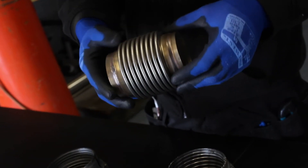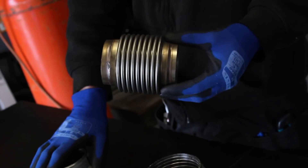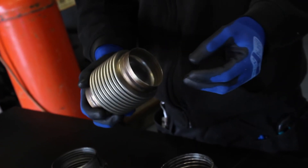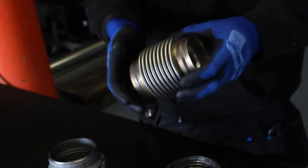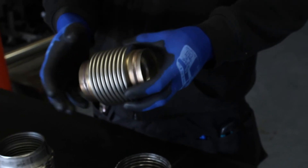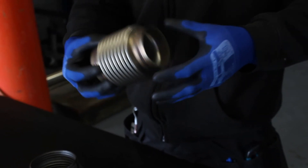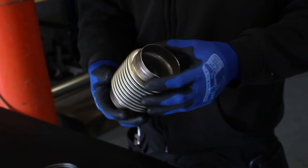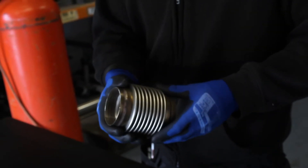The last type we've got here is what's known as a flex bellow. This is a completely uncovered type flex joint. It's pretty rare to see this used as a replacement for a standard flex. These are usually used on wastegate downpipes or on quite long turbo manifolds where you're looking to add some kind of flexible joint but you don't really need a huge range of movement — they're perfect where you need to account for some thermal expansion.